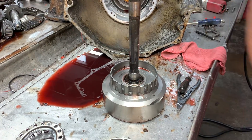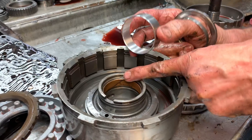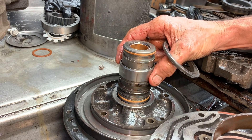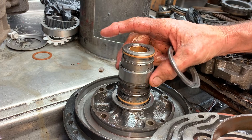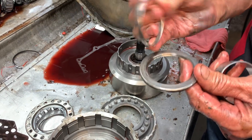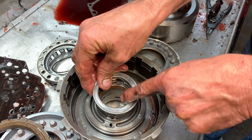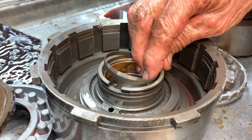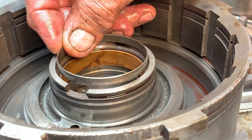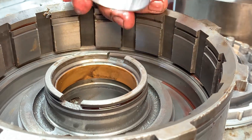When we go back with our tranny we're going to go back with a wide bushing in this drum right here. See how much wider this bushing is than that bushing there? A lot wider. This bushing here will fit that race really nice. But the problem is when you put this bushing in there, this bearing has a step on it — this step is actually broke off, it's supposed to be on there. So I've got to go find another bearing. But you put that bushing down just far enough where that step doesn't touch it, because that step has to set down in there. This bushing supports this drum ten times better than this little narrow bushing when you're hot rodding it.